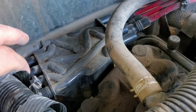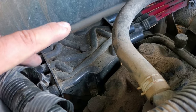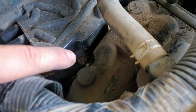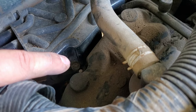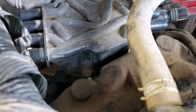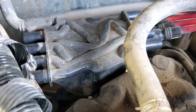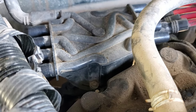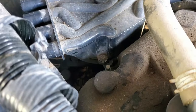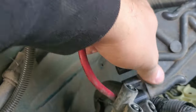You want to make sure you take your spark plug wires off first because they're gonna be on there pretty snug, and you don't want the cap being all loose as you're taking these off. You've got a little Torx head screw right there — I believe it's a Torx 15. Before you strip that screw, try the Torx 15 and make sure it's good and snug. If it's not, just step up a size — Torx 20 or something like that. You've got that screw and another one back there.